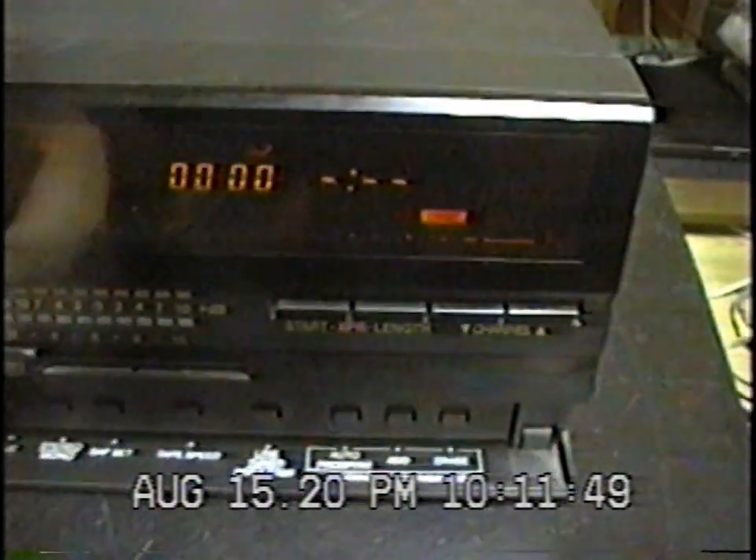There's a pretty nice VFD display which is still bright — the RCA-style VFD display with an orange color. RCA used this on a lot of their VCRs from the 80s and 90s. The VFD display itself is actually a light blue color, and there is an orange filter inside that gives it that warm orange appearance.